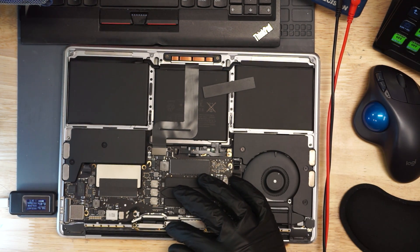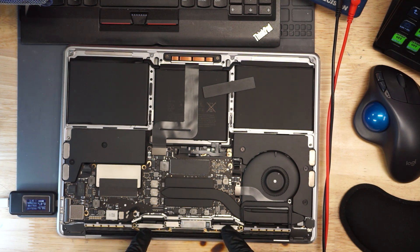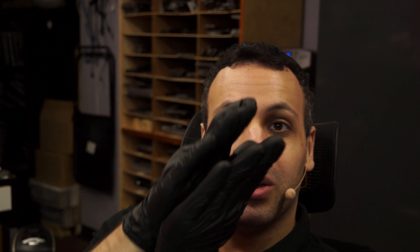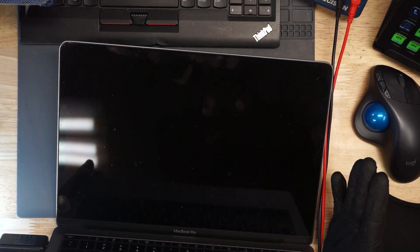This is going to be a known defect in a lot of the newer MacBook Pros. All the ones with a USB-C port, to my knowledge, are affected by this along with the new screen design. The new screen design doesn't just have a cable that attaches to the screen — it also has a little daughter board with cables that attach to another board on the screen. These flex cables manage to kill themselves and die. They are not cables that someone like me can replace; they are created when the screen is manufactured as part of the screen. When those flex cables die, the screen will stop working when fully extended, and eventually the screen will only work when the laptop is open partway. You kind of have to use the machine like this. These are very expensive screens — stupidly expensive. You can have a computer that is well taken care of, but in spite of that, this will happen. It's unique to this new cutting-edge design.